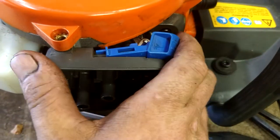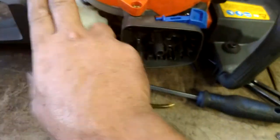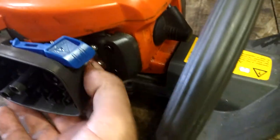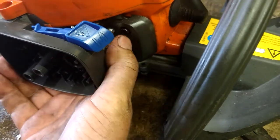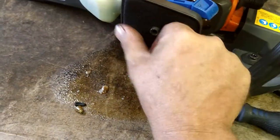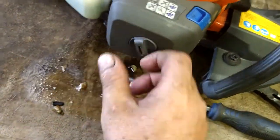Check the choke on top — on and off still work, so we're good. Tighten her down. Put some fuel in it and check to make sure it's priming up, then prime it. It's priming up — that's a good sign. Filter on, cover on, get it over that choke arm, and tighten it down.